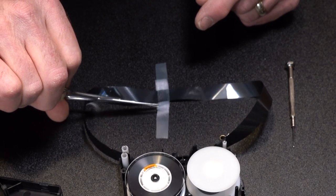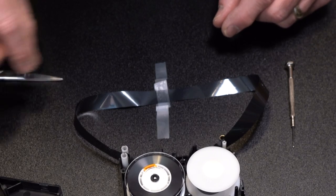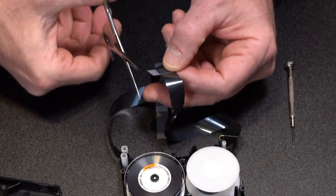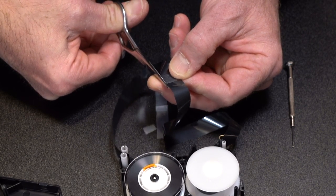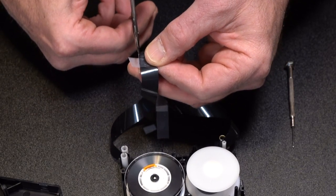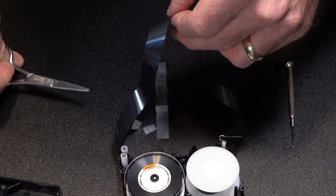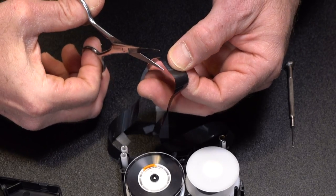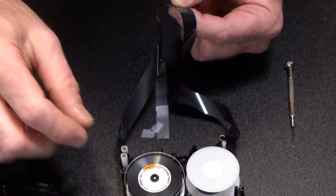Let's cut it away from the table and cut the excess tape off. Get it as close to the VHS tape as you can. If you cut into the VHS tape a little bit that is okay — it's better to cut into the tape than to have any sticky tape that could mess up the mechanisms inside the VCR. Let's clean that up just a little bit.